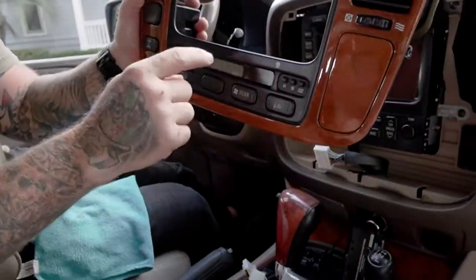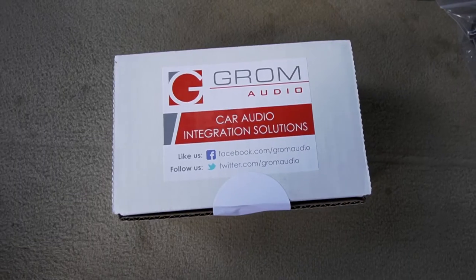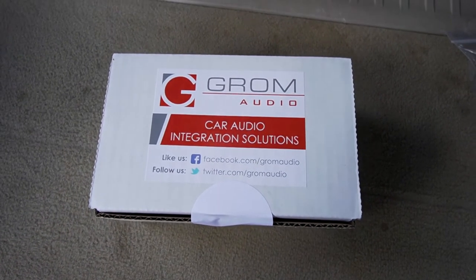Just that one plug back here for some of these other controls — I'm going to set this aside for now. For this we're using the Grom Audio Bluetooth adapter. I got it on Amazon; it seemed to have good reviews and high volume so I went for it. I'll leave a link in the description below, and by the end of this video you'll know if it works well. I have no affiliation with them whatsoever. The way this works is it's going to plug in here and this harness is going to basically interrupt the CD changer and go in line there. So you select disc on the radio and it'll basically turn this on and we'll be able to Bluetooth connect to the phone. There's also a microphone that will plug in for hands-free Bluetooth calling and that sort of thing.